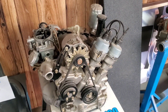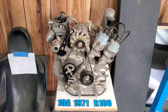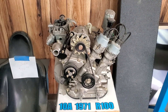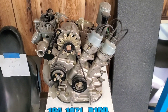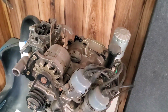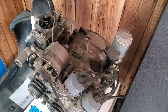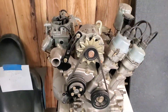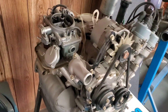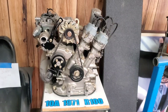Still running a metering pump — again, traditional features to the rotary engine that went on for a long time. As well as the thermostat placement and alternator placement. You can see where that oil filter also resides in kind of what I would consider the traditional Mazda rotary placement. Very cool Mazda Wankel — you don't see these every day.